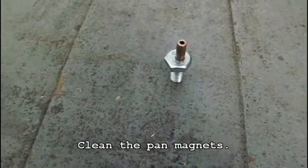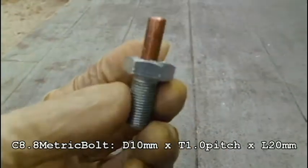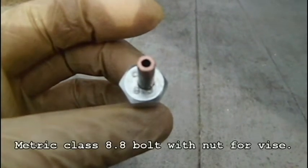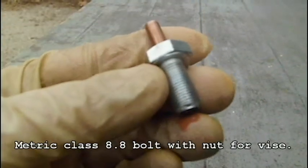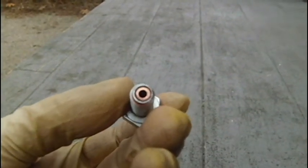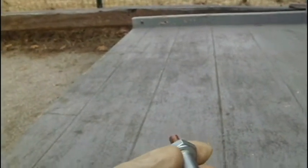Here's the homemade fill plug for the transmission, which is simply a bolt that has been drilled through and copper has been pressed in to make a nice snug fit. You need a soft bolt to do this — the metric class is 8.8, which is the soft class of metric bolt — and that's a 1.0 pitch, somewhere between a half inch and an inch long. You just drill your pilot hole from this end and ream it out with, I think, a quarter inch. Otherwise you'd have to pay about 40 bucks for the nice little knurled tool they sell, but this is probably better.